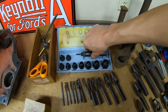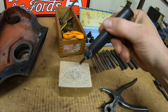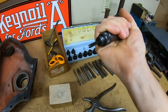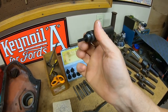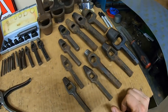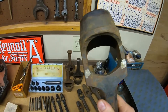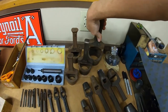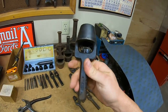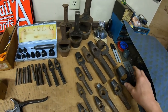This is another handy punch set made for paper — it has mandrels of different sizes that thread onto a driver handle. The driver handle has a spring-loaded center point to help you center up with the hole, and it's spring-loaded so after you pop the blank out, that center punch portion spits the little round slug back out. Over here you start to get a little more specialized — I don't use these as often, unless I need a large opening. These are mostly swap-meet finds; any time I find a center or hole punch that looks good I'll pick it up, because a lot of times you need a hole of a specific size and having these on hand is really handy.